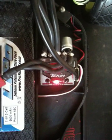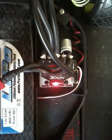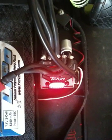I can show you — if I pull back my brake strength on this radio just by 20% and I hit full brake, now you can see the LEDs light up but they do not flash, indicating I am not getting full signal. So that's something to consider. These LEDs are really useful and helpful to show you what's going on with your speed controller.